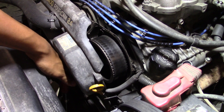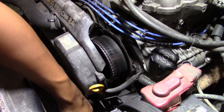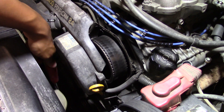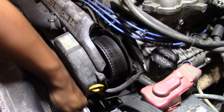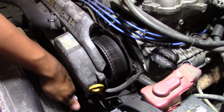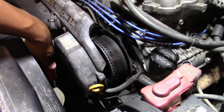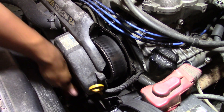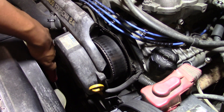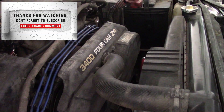Here's a visual of the rotation of the motor. I'll go through a full revolution so I can inspect every inch of the belt along the way. I'm looking for any cracks or any visual fraying of the belt. This is not a foolproof method of saying the belt is good, but it's a good way to identify any emergency cases where the belt needs to be replaced immediately. In my case, the belt looked pretty good, so I feel comfortable driving a couple extra hundred miles on my road trip prior to replacing it.